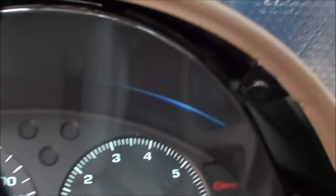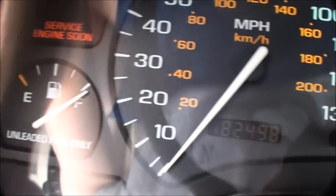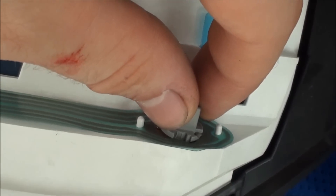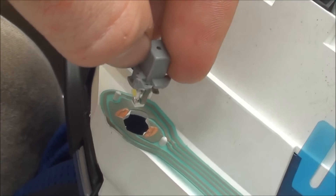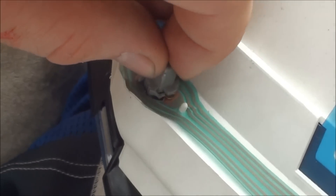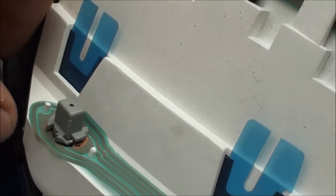Now it is on — it's a little bright out here. There's one theater light that's good. This one I'm going to have to turn around. The odometer is not on, so I'm going to have to flip that one around. And also this side right here is not on, so I'm going to have to flip that one around too. All you have to do is remove the bulb, flip it 180 degrees, and then stick it back in. Because the LEDs are polarized, they can only be put in one direction. If you notice one's out, just flip it around — that's all there is to it.